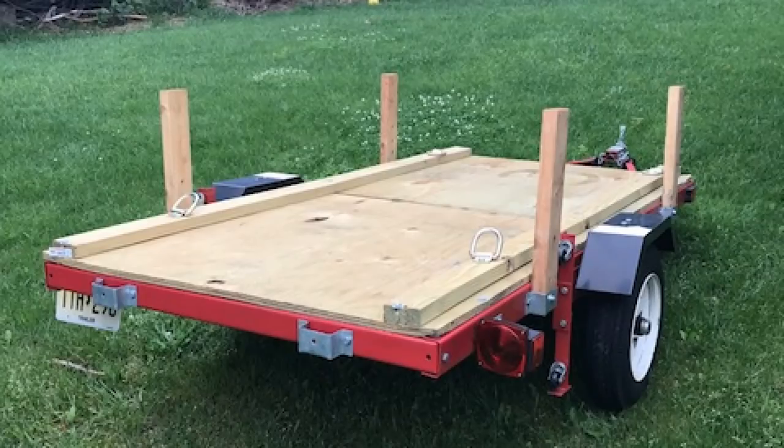Not a single issue using this trailer for a long road trip. As far as the flooring goes, I opted to go with what the directions suggested: a three-quarter inch pressure treated sheet of plywood. A four by eight will fit perfectly on there. If you want to maintain the ability to fold the trailer, you're going to have to cut that piece of plywood in half — a four-foot by four-foot on the front and another four-foot by four-foot on the back. It folds up directly in half and it works pretty well.